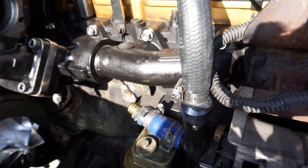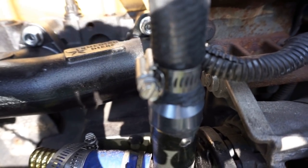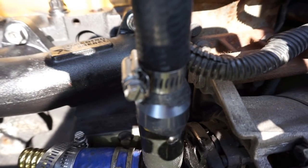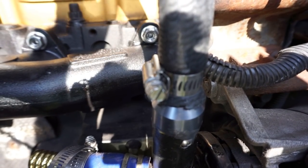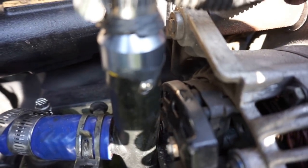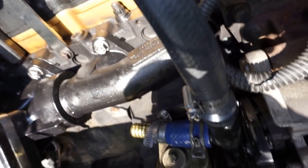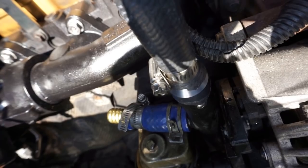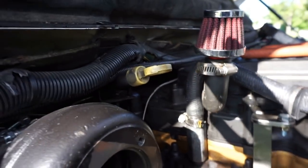Ooh, man. Next day, it is hot outside. So I went ahead and got the coolant standpipe delete done. Everything looks super fresh. I did two things. One, I didn't follow Pusher's instructions, but before I installed this, I put some black gasket sealer, like silicone, around the fitting before I inserted it into the pipe, just for extra assurance, because from looking at it, the only thing keeping coolant from leaking out of there is that O-ring. If that O-ring was to get pinched or weakened, maybe that sealant would act as a barrier a little bit to help it out.